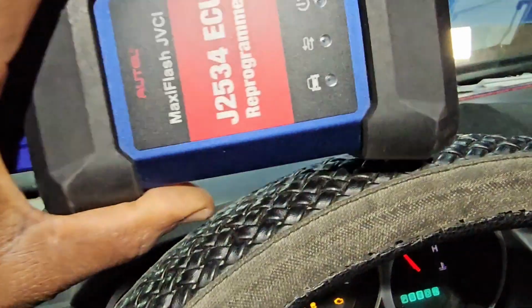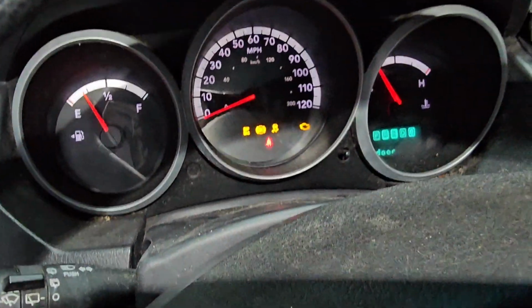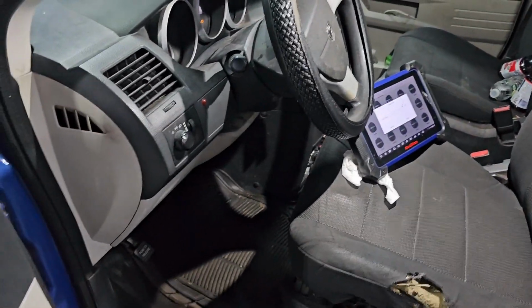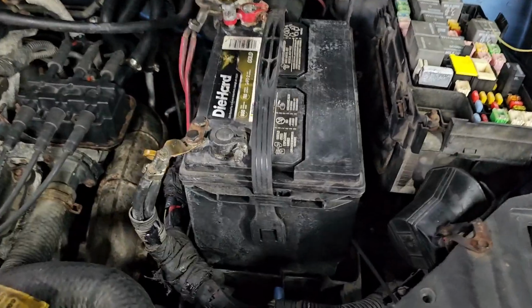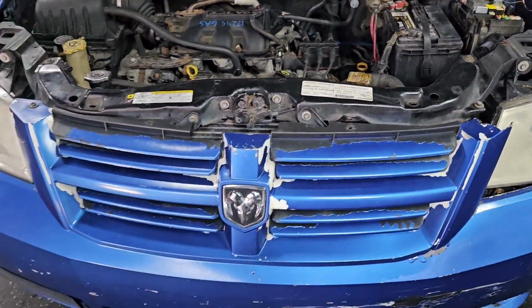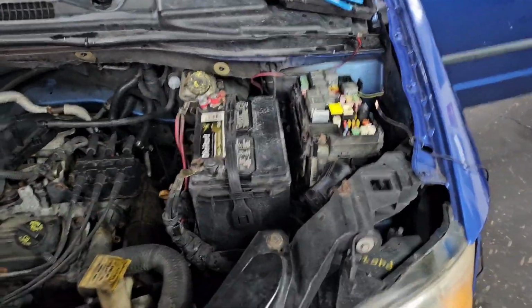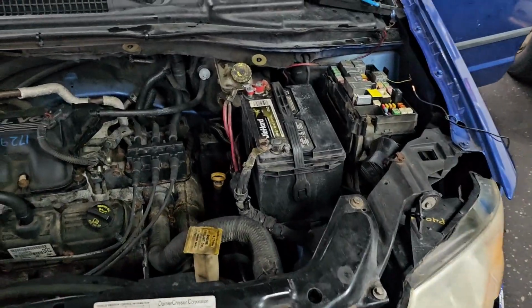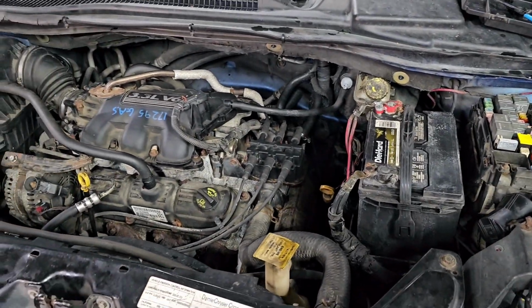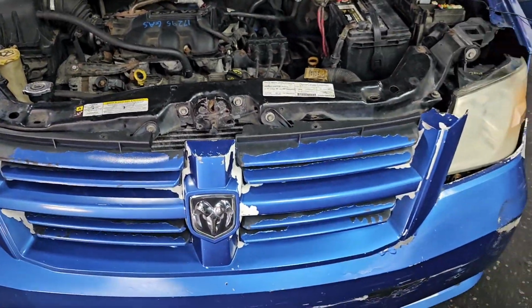It never lights up, you see. Our OBD is no good as before, so I have to send it to get another one fixed. So we're gonna clean the terminal, we change the interface, then we come back. Battery terminals must be good, please. We learn from here, battery terminals must be okay. Then I'm gonna change my interface and we come back. When we come back, I will show you the car cranking, no start. We have a code, P0688, what it is and how to fix it.